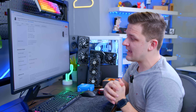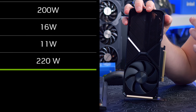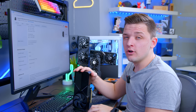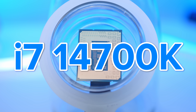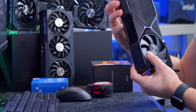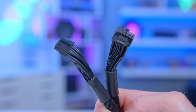With your CPU and case now selected, what are the best power supply options for the 4070 Super? As mentioned earlier, the total board power of this card is only 230 watts — incredibly efficient for so much graphics power. 230 watts is basically half of what an i7-14700K pulls on its own. Aside from needing that 12-pin power connector or using the included dongle, you don't actually need much wattage, and that almost becomes the challenge when buying a PSU, since you often have to buy high-end units just to get that 12-pin connector.